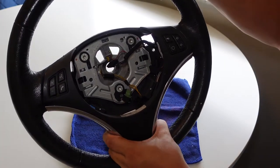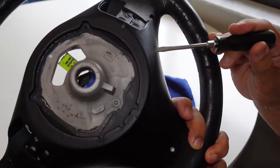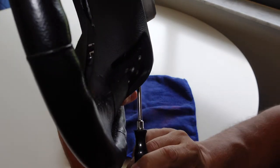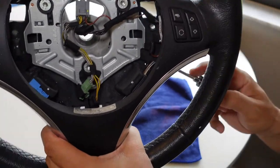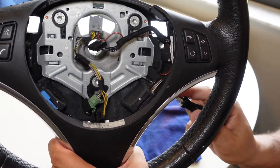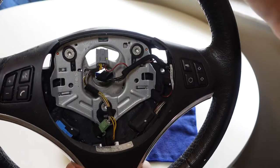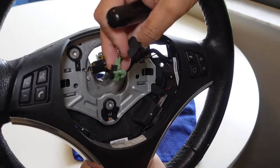On the back of the steering wheel you're going to have a slot on either side. It's like a little tear in the material — in my case the vinyl. You push in your tool, a flathead screwdriver, on an angle towards the back of the steering wheel. You'll see the screwdriver head pop in and you'll feel the tension on that spring lever. When you push that in it releases the tension on one side, you pop it out, do the other side, and you're done.